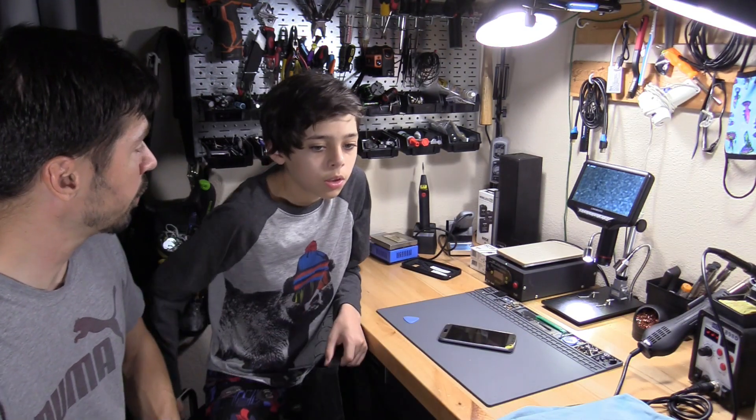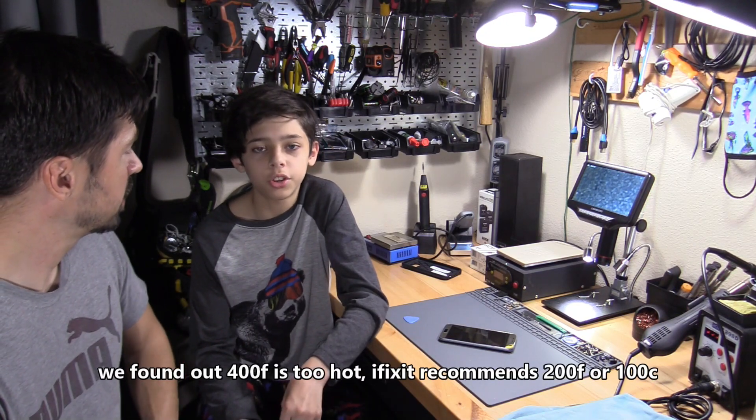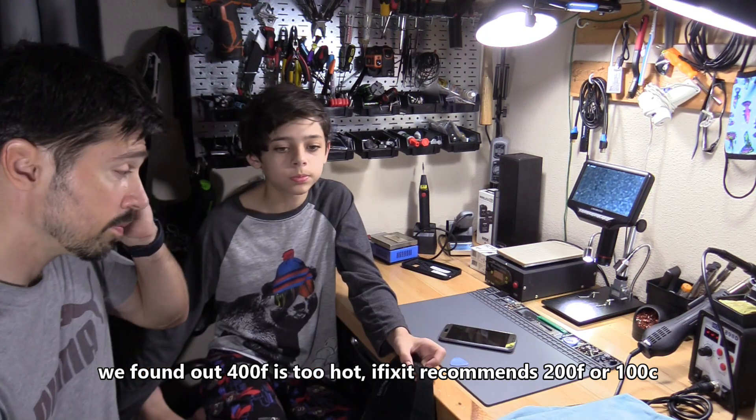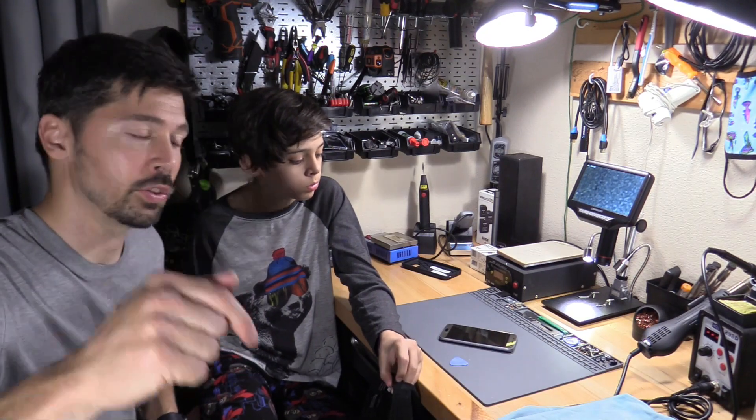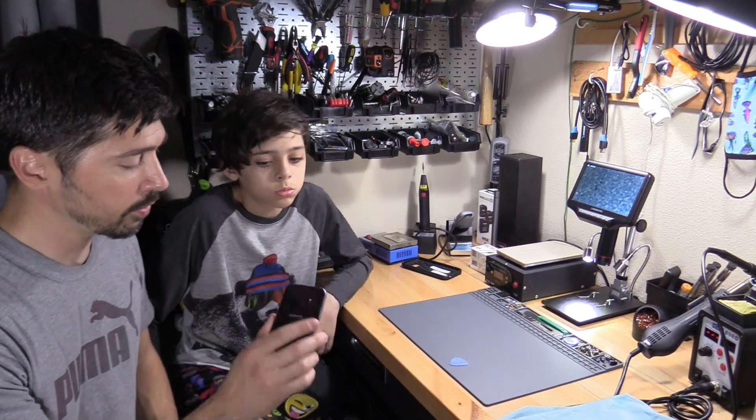So Devon, what did you learn? Did you learn anything besides not throwing your phone? I learned to get a heat gun and put it on 400 degrees Fahrenheit, and then after a while it will loosen up and you can take the screen off. It was expensive — I got it on Amazon. The phone cost $200 and the screen was around $100 to $130. It's a learning experience — if you teach your kid to repair it, most likely they're not going to try to break it again. I don't throw my phone, I drop it.